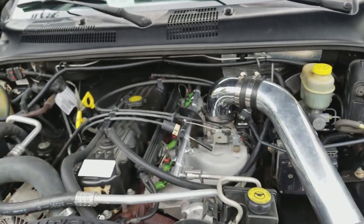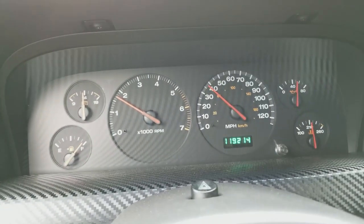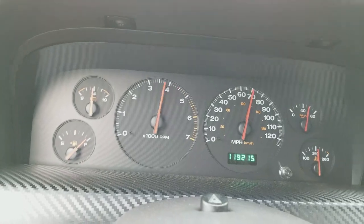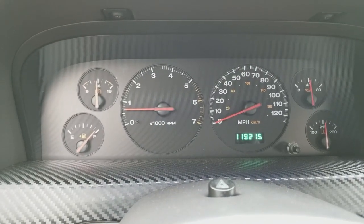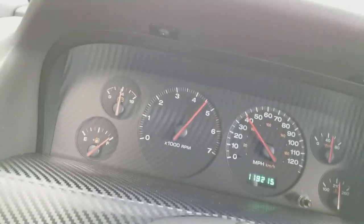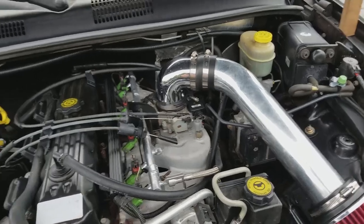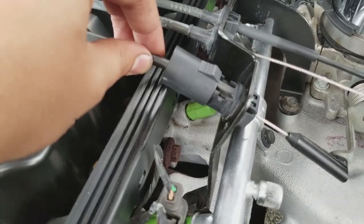Let's go see what it shifts to and we'll come back and see how it did. I'm in Mexico, so this is probably not going to be the best clip in the world, but here it goes. So you guys saw it actually revved higher than 3500 — it went to about 4,600. I have this thing off again; I'm going to push it in just the slightest bit more and we'll go from there. I think that was probably too much — maybe right about there.